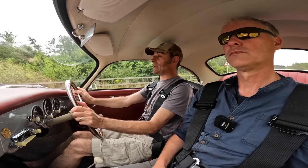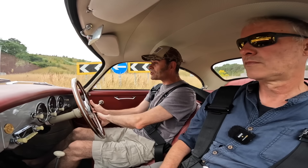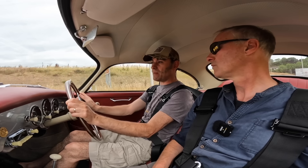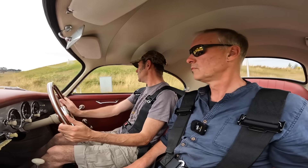For those not familiar with how a manual gearbox works on an electric motor, let me demonstrate — we're coming up to a roundabout. I'm in third, so all you do, just like in a normal car, tip the clutch and down into second. It's exactly the same at junctions and roundabouts. The motor's got to be in its power band, and we've sized the motor accordingly for this car and the rev range — the maximum revs of a Hyper 9 is realistically around 6,000 RPM, which is pretty much the same as the original engine. Going uphill you'll hear the motor and drivetrain getting high in the RPM, and then you need to change gears.